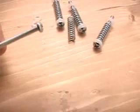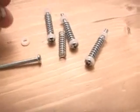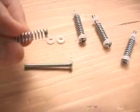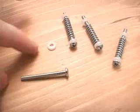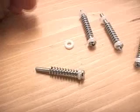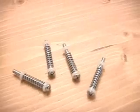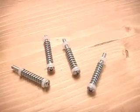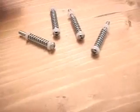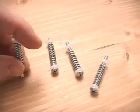Now this here is a screw. For each screw you also have two nylon flat washers and a spring. First, put the first nylon washer on, then insert the spring, and finally insert the last nylon washer. Repeat this process three other times and you'll have four assemblies.